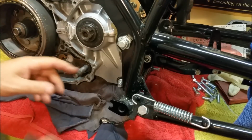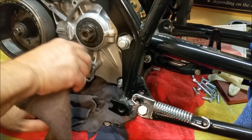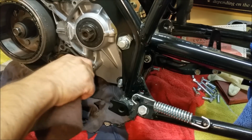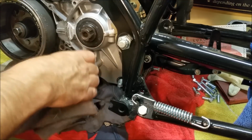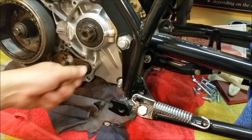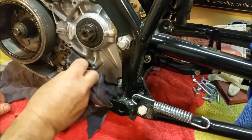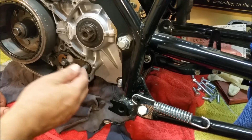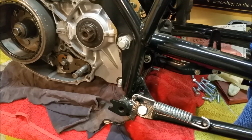Now, I always repeat myself. You never would clean it like that, always in an annular fashion. That way, you're not going to get issues with oil leaking out of there. It's just great, this stuff. It's brilliant. Okay. We can also pop a bit of clear sticky tape around there so when we drag the seal over, the spline doesn't cut it. I might put a bit on. Let's see how I go. Hang on a sec.